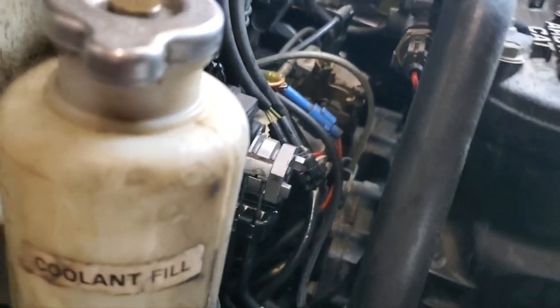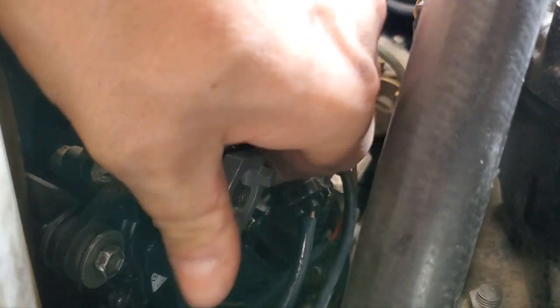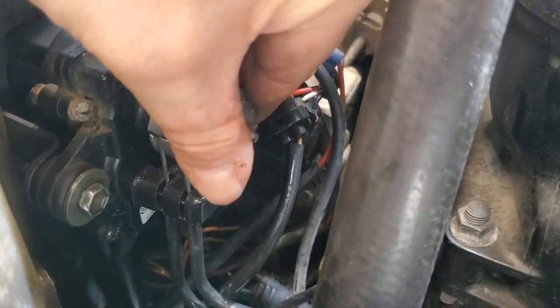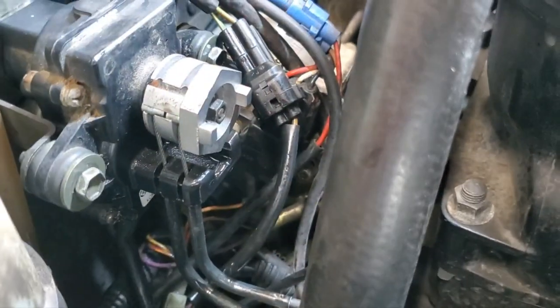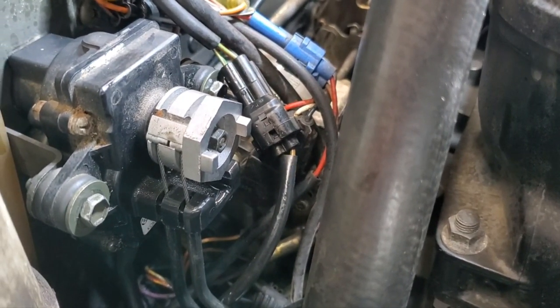Okay. So then I went ahead and I just kind of tested my servo by hand a few times to make sure that things seem to be rolling smoothly. They do. All right. So you want your servo to be basically these notches level with the ground, parallel to the ground like this, right? So straight across. So that's where your neutral position is. All right. So now, like I said, we're going to leave the cover off.